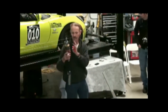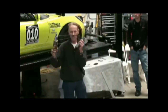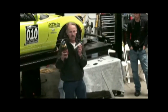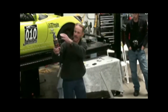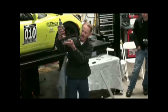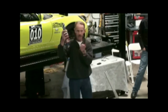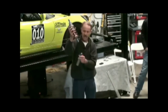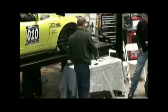Nitrons are great — I've used them for years. This one here is their GT3 setup, which is their gorgeous racing shock. What's nice about this shock is not only can you adjust the spring perch, but the bottom of the shock adjusts also, which allows you to fine tune corner balance, droop, and everything else. It's a great setup.